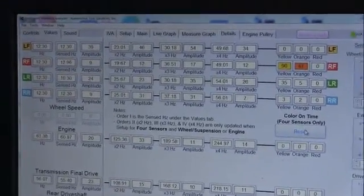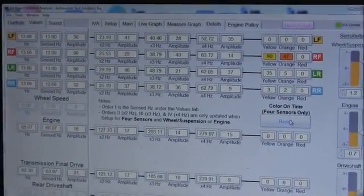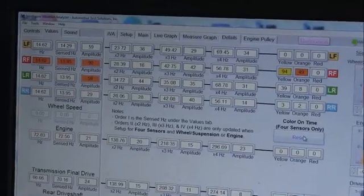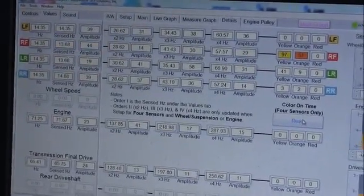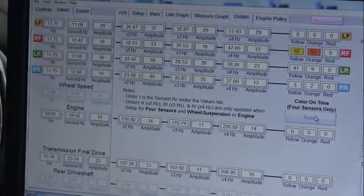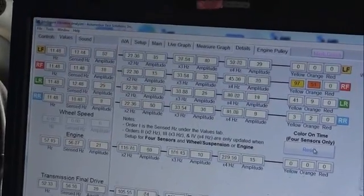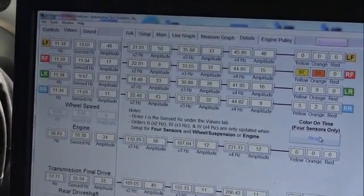We're going to get in it here. We should vibrate. Vibrating pretty good right there. Again, I can see it's the axle and the axle support, but mainly it's coming from the whole arm. We're on the right front, the lower arm, so it's coming from the outer assembly.